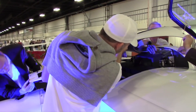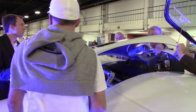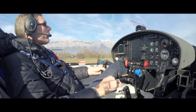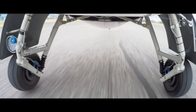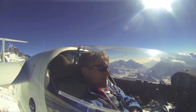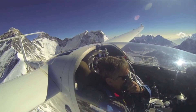Connected to the wonderful folding propeller by a carbon fiber driveshaft, we have a Rotax 914 turbocharged engine rated at 100 horsepower continuous and 115 horsepower for five minutes at takeoff from short fields. The Rotax is a standard 914 and burns approximately 3.7 gallons per hour at altitudes above 10,000 feet at cruise speed, making the range on this airplane truly astounding — 950 nautical miles is typical.